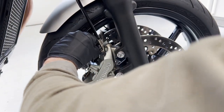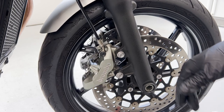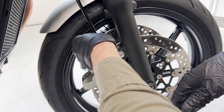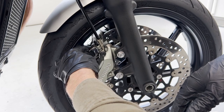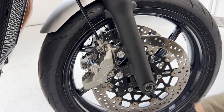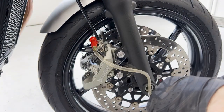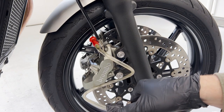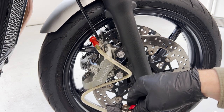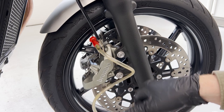Remove the dust cover entirely — you can't just pop it open because you need to get access to the place where your wrench is going to go. We only need to loosen it just a little bit, maybe half a turn or so. We will attach our vacuum pump. Once you've got your vacuum pump energized, you can just open up the valve and you see the fluid coming out. We'll keep our eye on the brake fluid reservoir and make sure that it doesn't drain too far down. When it does, we'll shut the valve.